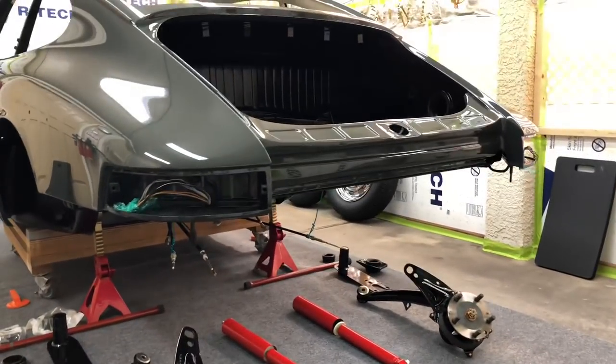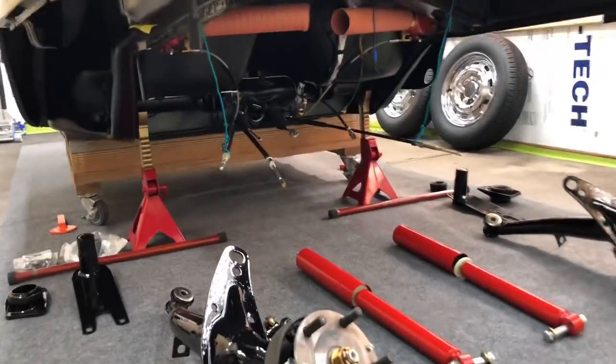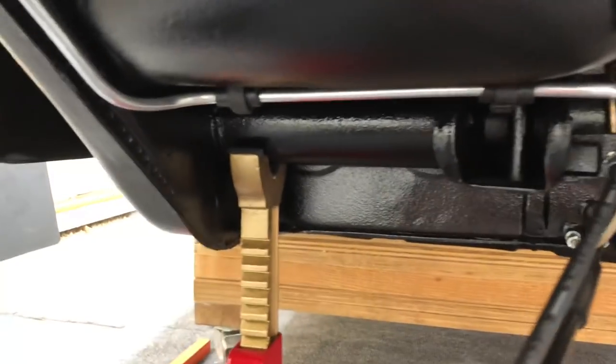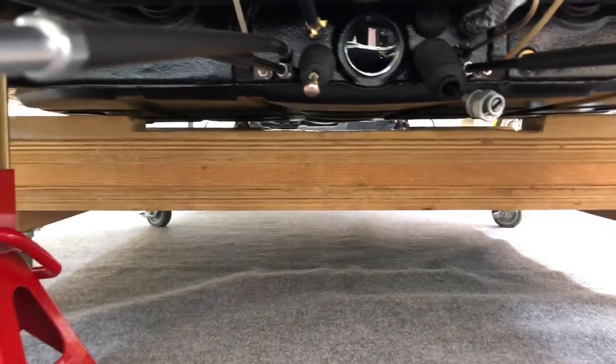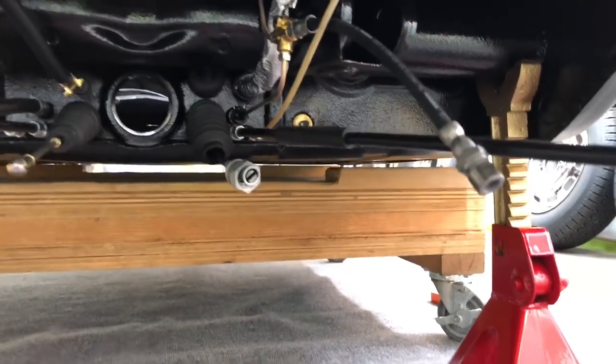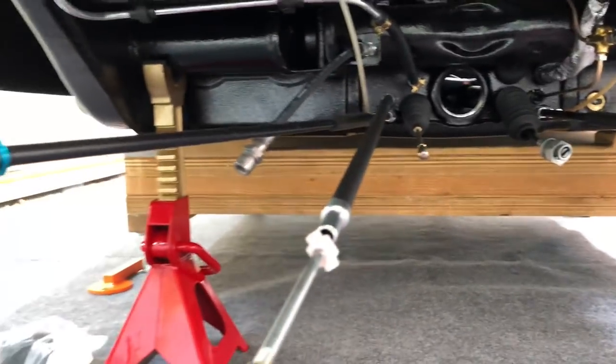You can see I've got the rotisserie pulled off the car now, sitting up on jack stands front and rear. I've got the jack stand supporting under the torsion tubes there. And as a backup precaution, I've got our dolly adjusted down to suspension height, but it's not actually sitting on the dolly — it's just kind of a backup as we're pushing, tugging, and pulling.